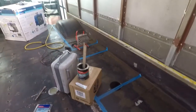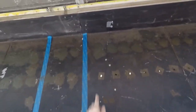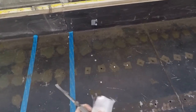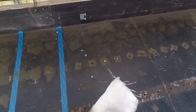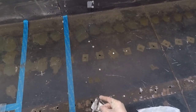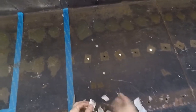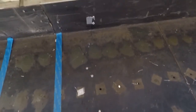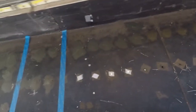First I take a little bit of Bondo glass and dab a little bit on the holes — just enough so the fiberglass cloth can stick to it. It's easier to spread on top of it with the Bondo glass and hardener after. So I come over here, cut out a strip — I don't need it to be big, just enough to cover the hole. I do multiple at a time, come over here and put it like this.